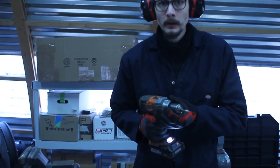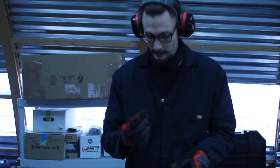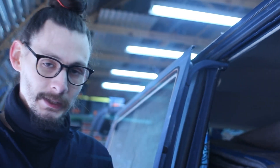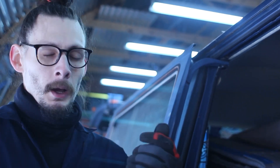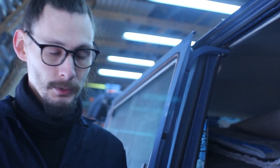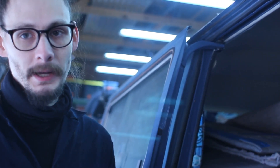This is an example of needing to modify a tool. The spot weld tool has got a little nibber on it that helps it ride where the spot weld is. What we got to do is make it so the nibber can ride in a hole and not in a divot, which is normally where you'd pop it. You do a center punch, then that nibber would drive into the center punch and spot weld it out.